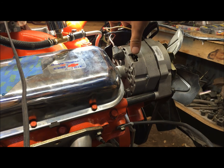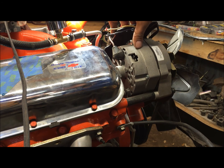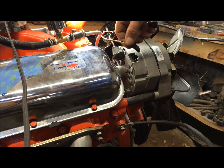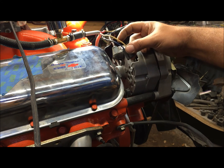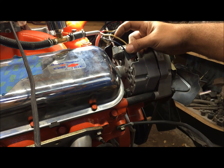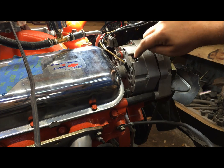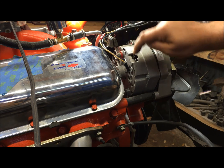It's very important that the blue wire and white wire are in the right place. If you're new to this, the only way I can suggest to remember it is: this is anti-American — red, white, and blue is American, so this is anti-American: blue, white, red. That sounds stupid but when you start getting into this you're going to forget which wire goes where and you could totally screw everything up by having these switched. Number two is the voltage sensing wire. In the harness we connected this straight to the horn relay hot. You can jump number two straight to the lug, some people do that, but in my opinion that really doesn't look clean.